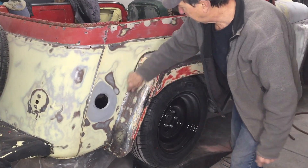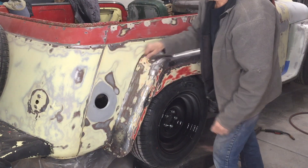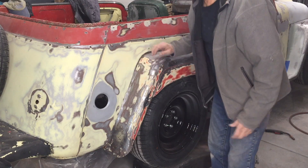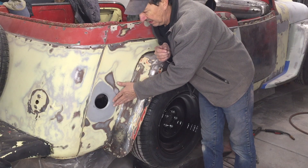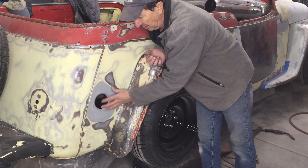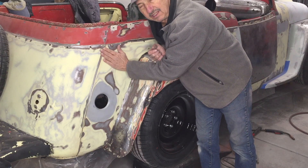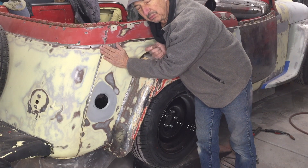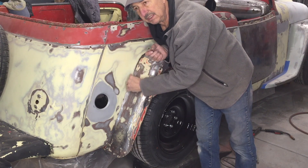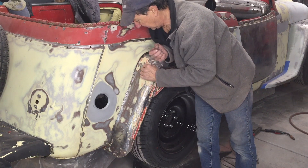There's a really tight seam along here that I can't get into with sandpaper, so I'll run a knife edge back and forth in there to clean it out as much as possible, then force in some all metal filler. For an area like this I like to use all metal — I can use fiberglass-reinforced filler where I've been welding and want to cover a weld, but for something this thin I like the all metal because it flows really well, is really smooth, and you can force it into small crevices. The fiberglass kitty hair in other fillers doesn't allow you to really force it into areas like this.